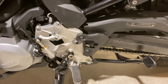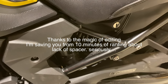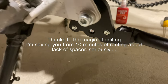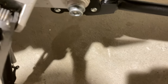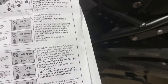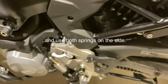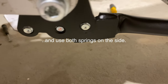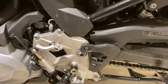Fitment is perfect. I would have loved to see a spacer here. Wait — what is the spare spacer for? The spare spacer goes behind this bolt — right in there. 40 newton meters on that bolt. Don't worry about torquing it down too much because there's a spacer behind it. That sneaky little spacer — right there, number 12. This is no longer a problem. I would still like to see that lower center stand bolt be a little bit longer — see how it doesn't come all the way through. Easy fix though, just buy the right bolt. But getting this thing off the center stand is super easy.